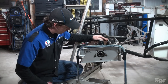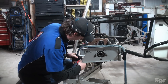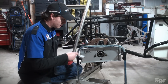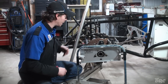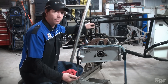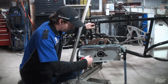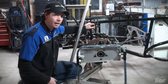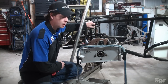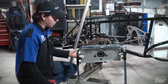On the left side, set the gauge up at ride height and align the dial indicator to zero. I like to take the car into the first amount of compression first, check the reading, see where it goes — then go to the full extent of rebound travel, as far as you can before the tire lifts off the ground. Whether that means setting the gauge at the two-inch mark or the one-inch mark, adjust it wherever you need to on the front end. Use a basic floor jack to raise and lower the car.